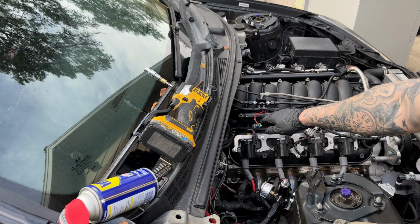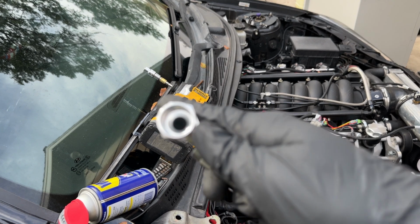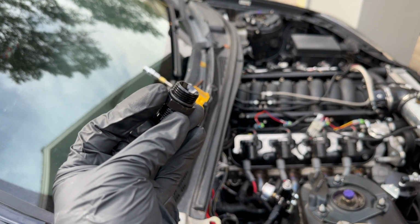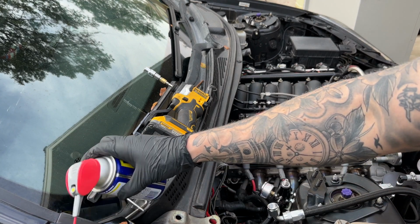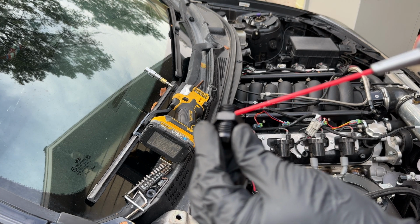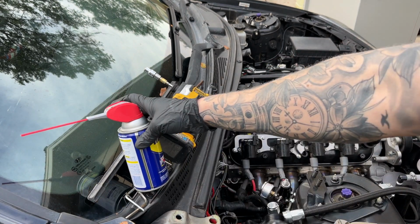You have to pay attention to the fitting of your fuel rails. It's either going to be AN, which is like this, kind of a tapered fit, or it'll be O-ring. I don't know if you can see that. There we go. If it's O-ring, make sure that you do, again, just a little bit of WD-40, because these are not intended to be dry when you install them. A lot of times just a little bit goes a long way.